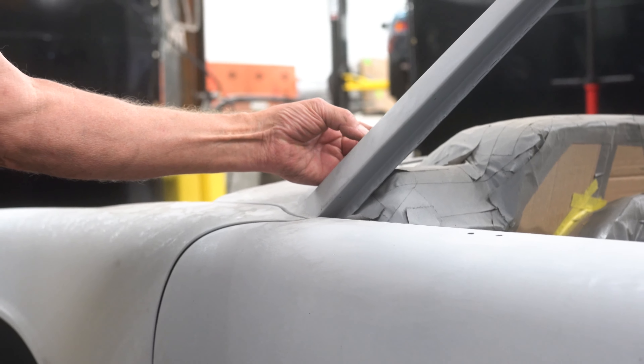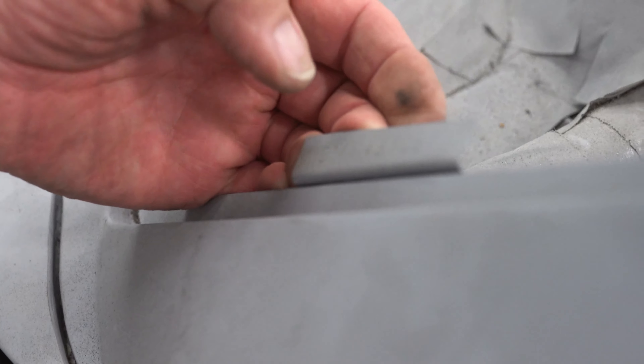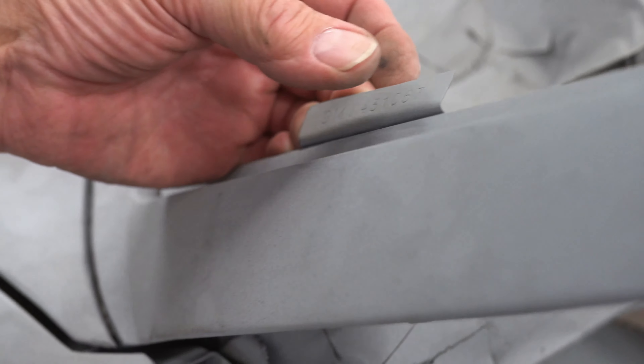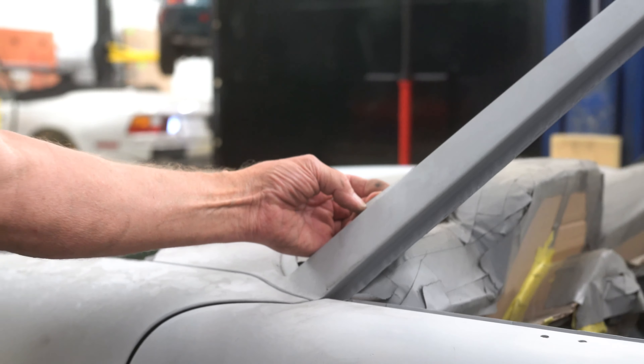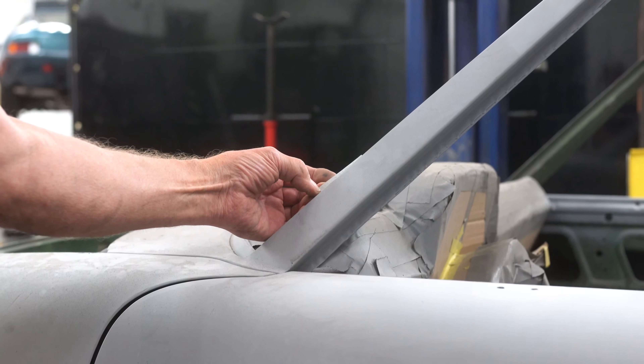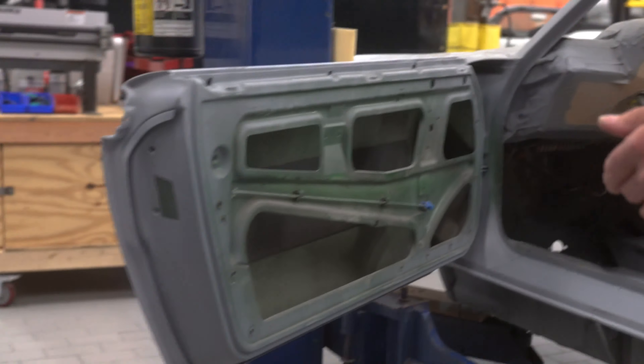All USA 914s had serial numbers on the window post like this. The six-cylinder, sort of rudimentary, looked like somebody took a piece of metal and just cut it with snips and stamped the number in here. The 914 four-cylinders were more finished and had an edge on them. You can see 914-043106-7. Since they started at 50, this was about the 157th car done. The 914 means it's a six-cylinder, and the zero means it's a 1970 model.